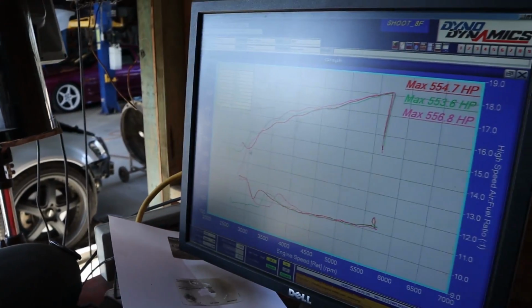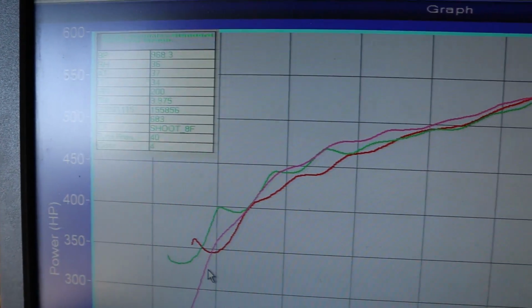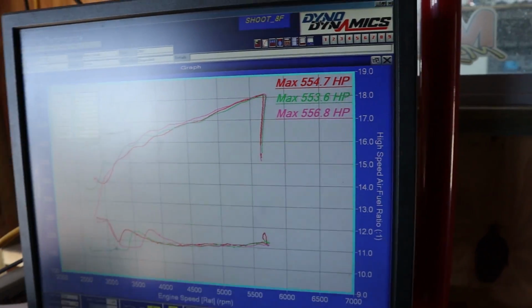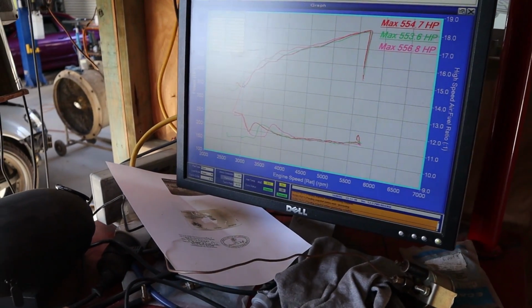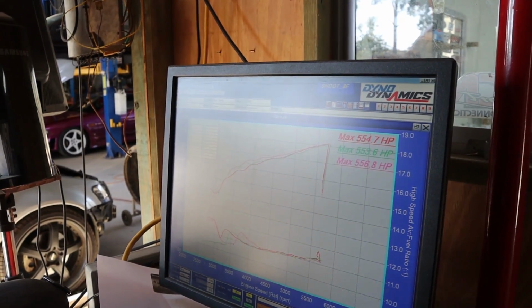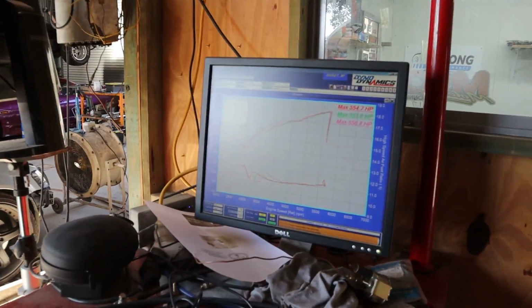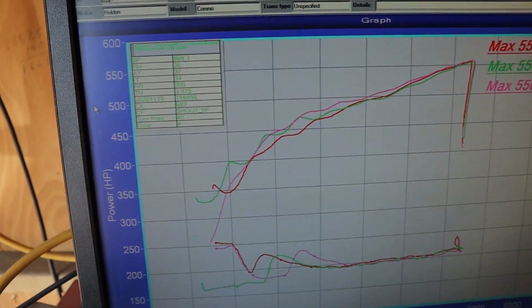It's got traction for now, which is good. When we jammed it, you can see where it rolled up and rocked back. It's doing that rocking thing, which we can sort out. But you can see by 3,000 revs, you're over 350 at the wheels, it's just bang. And that's with that converter and the way it flares. If you drive it on the road and stomp it, it'll just go bang. Light them up. Tire frying material. So at the moment, we're only turning it to 6.5.